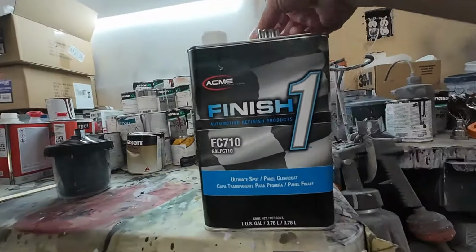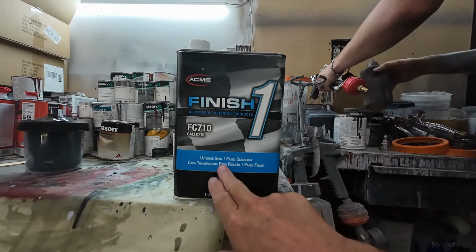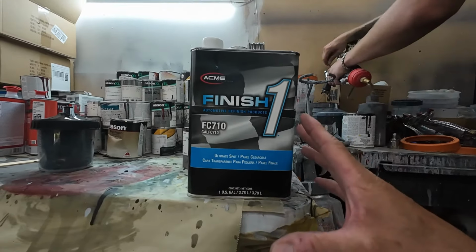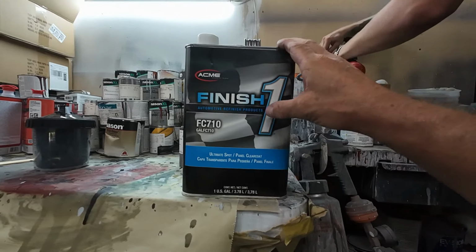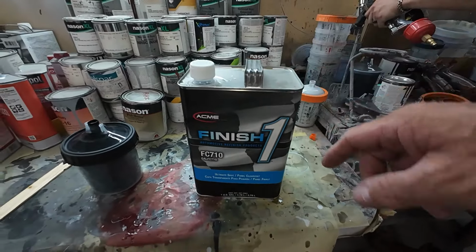In clear, we're using the Finish One FC710, but it's made by Sherwin-Williams. It's a spot panel clear coat. We're going to use a slow activator. This clear coat mixes up 4-to-1. It's a really good budget-friendly clear. If you want to check it out, I'll leave a link in the description.